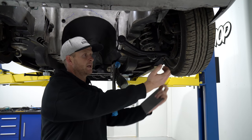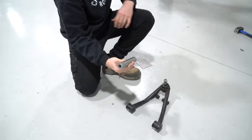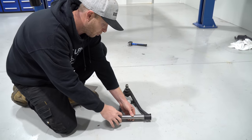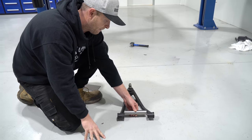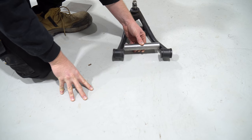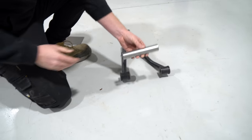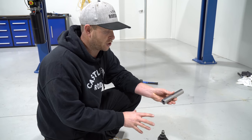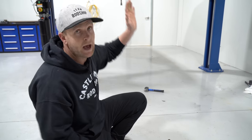Down on the ground I've got the opposite side lower arm pin and arm - there's normally a steel washer either side, but we're going to shorten the arm up. As you can see this arm tapers, so as we bring that pin down there's going to be some drama - the back side of the pin will have to be trimmed down because of the taper of the arm. I'm going to send the lower arm pin and the lower arm itself up to the guys in the welding bay for modifications - they'll probably just tack it up for me, then we'll jam it back in, check the other side, and if we're happy we'll pull that side apart and repeat.